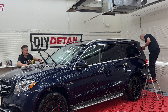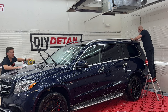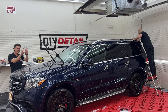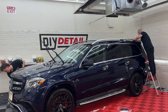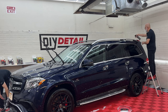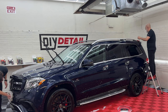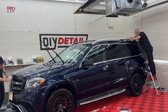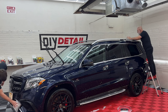If you're dealing with tree sap and gunk and know you're going to polish after, should you get more aggressive with the towel? You're asking for trouble, and your clay towel won't last as long — it's not designed to be used with pressure. If you use this towel without pressure, it will last hundreds of vehicles. Use it, no pressure, rinse it out with water, dry it clay side up. You'll know when the towel has seen better days when chunks of the synthetic surface start coming off. Proper maintenance will definitely make it last a long time.